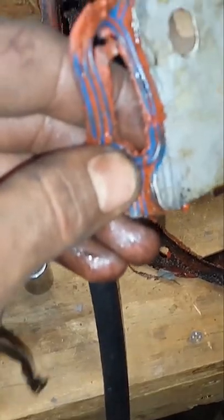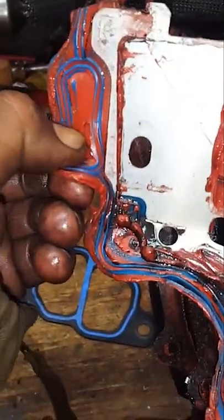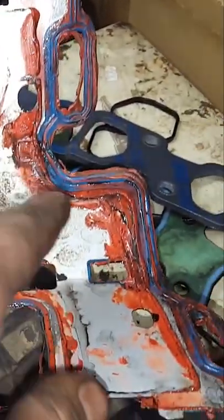Let's see where it was leaking from — right there, maybe right there. Look at all the silicone on it. When you put it in the presence of gas, you know what happens to it. You can see it's all around here — it's not sealing anything, it's just filled in. Somebody tried to get away with reusing the gasket.